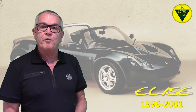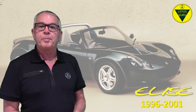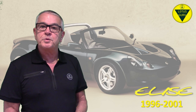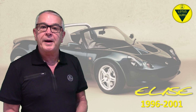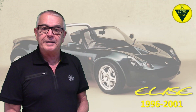With the introduction of the 111S and the sport variants of the Elise, these had Perspex headlamp covers fitted to give them a more sleeker look, but the standard variants did not. Lots of people at the time wanted to fit these to their standard Elise and went out and bought the covers. The problem is that the original ones are 4mm thick and if fitted to a standard clamshell, they stand proud of the bezel and it doesn't look too good. So Lotus introduced a thinner version as an accessory, which was 1.5mm thick. If you'd like to buy these from Lotus they are still available, but they will set you back about £430 each. Much cheaper versions are available from EliseParts.com at around £60 each.